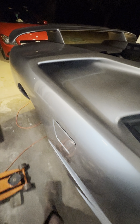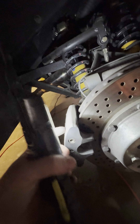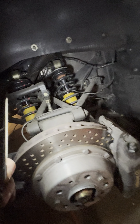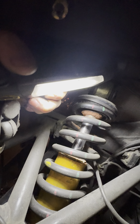I got everything done — fixed the wire harness and all that mess. I'm going to do an oil change on it. Got that brake light to work. On the rears, I have to do the parking brake — I don't know if the cable stretched, but they just don't work. They seem to have enough bite left, so I'll probably just try to adjust the cables. The rear end is fine for now, but this winter I am going to have all the shocks rebuilt. You can see they're just starting to dry rot and fall apart, pieces just falling in — they'll probably leak pretty quickly.